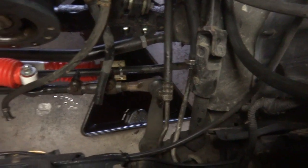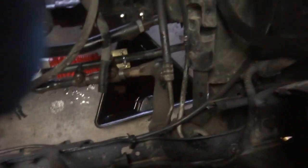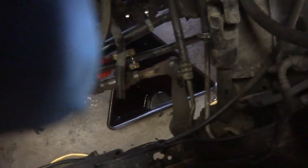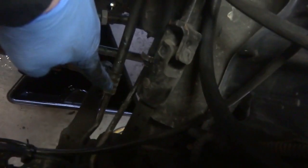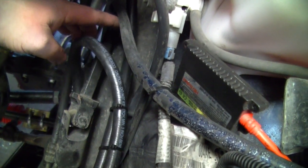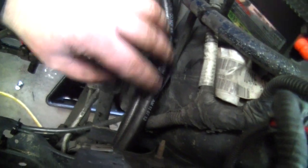I just got the line on the return on the bottom. Realistically, I don't have the tools to bend that pipe — you'd realistically want to cut it and then bend it up at a 90 degree angle here to feed it to your power steering cooler — but I don't have a pipe bender to do that. So what I'm just gonna do is do a loop around to the cooler, which is a little bit longer but it'll still work. I got everything connected and I'm gonna have to put a piece of rubber or something around here because it's gonna rub on the steering shaft and eventually come through there.